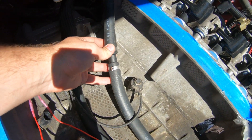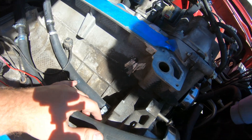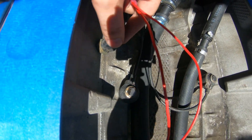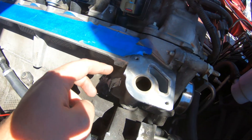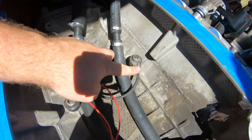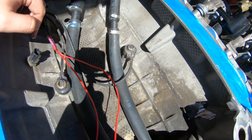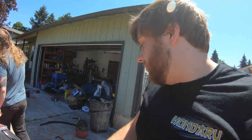We have to take this — I think it was like five-eighths or whatever — line to the coolant crossover, or rather to where the pump area is. This line comes up right here, ready for the coolant crossover to be put on. This cylinder head temperature sensor wiring harness just needs to be extended about 10 inches so it comes out towards the front. That section right there where one of the bolt holes was, you need to take an angle grinder or hacksaw and remove it. Also the knock sensor bolt tops — I just ground those down for more clearance, just enough to where you can get a socket on it and tighten it. So now we're gonna move on to the next steps: get the coolant crossover on and then work on getting the manifold installed.